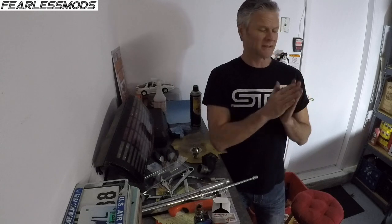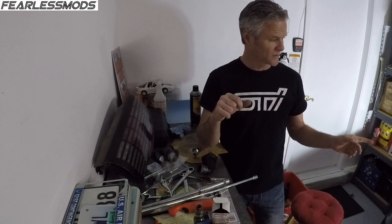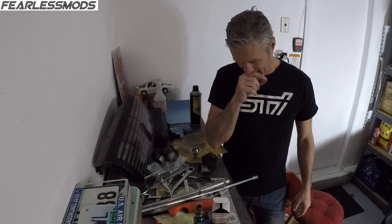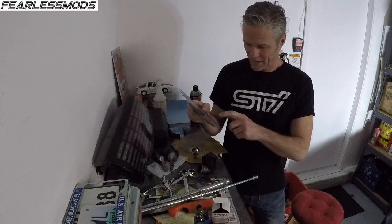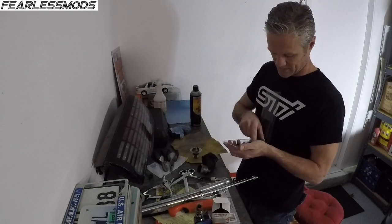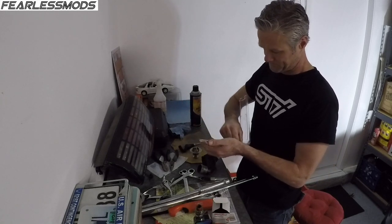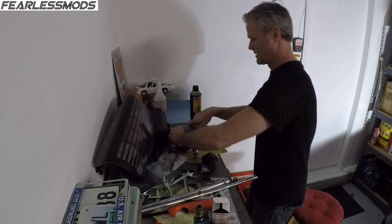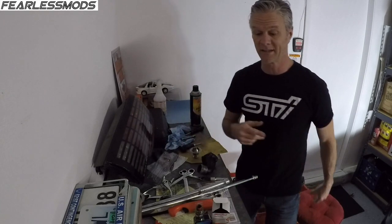Start looking at the, it's got a stripped bolt, so I'm not going to be able to get the drill in there behind it with the rad in there. So what I'm going to do is see if I can at least tap the thread down in there into the existing hole to be able to then put in the helicoil. But first, we've got to go ahead and get that side of the gasket cleaned up.